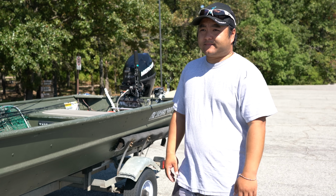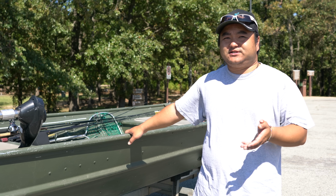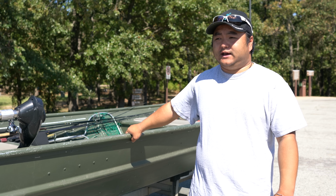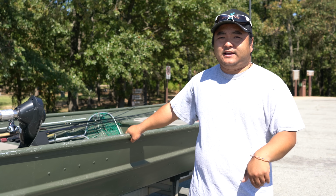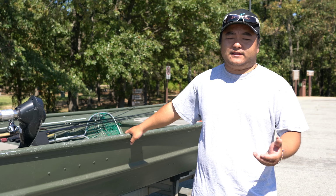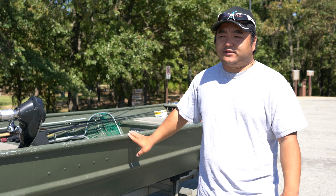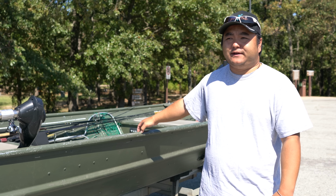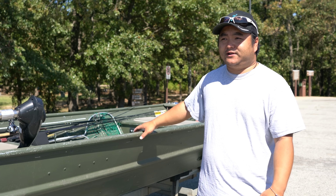Talk about your transmission and maintenance on it. Oh, the transmission on the Honda Civic, maybe because it's a manual transmission, it is better off for towing because we can select which gears we want to be in. For the most part, if I can feel a little bit of stress on the engine, I'm in 4th gear. If I'm going up hills, it's either 3rd gear or 2nd gear, and I'll let the revs hang at 4,000, 5,000 RPMs. And I think that's just healthier for the transmission. For regular maintenance on the tranny, every 2 years I flush the oil out, and I use Honda fluids.